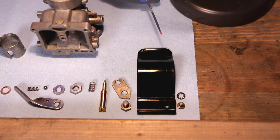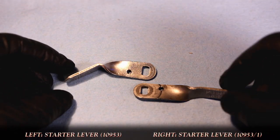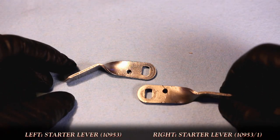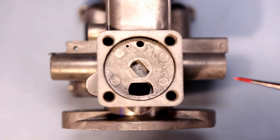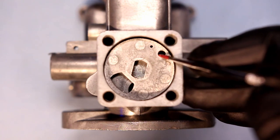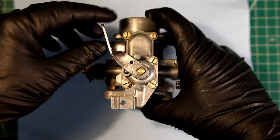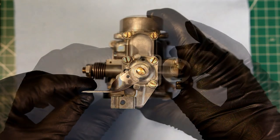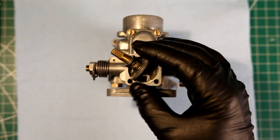Now starting out, the starting lever is not meant for a TRW, but a 3TA instead, and here's why this is important. The disc that the lever controls determines how rich the fuel mixture is, with the large window at the 6 o'clock position, we're at the starting stage. Rotating clockwise you get to the middle running position, and the leaned out position for a warm running engine is next. With the lever as it is, these positions would be backwards and you'll end up running an overly enriched engine full time, if you can even get it started.